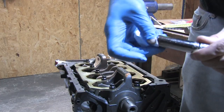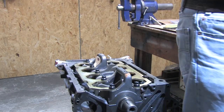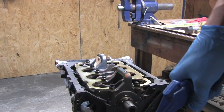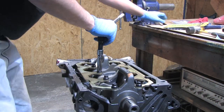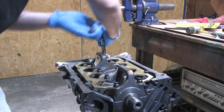The GSX's old 7-bolt block was powder coated. It won trophies partially because of this, and it's part of the car's personality. Because it deserves it, and for no other reason, I will be powder coating my 6-bolt block again. It's costly, it insulates the block, and it doesn't resist everything, but it's more resistant to chemicals than paint is, and it looks great on an engine stand.